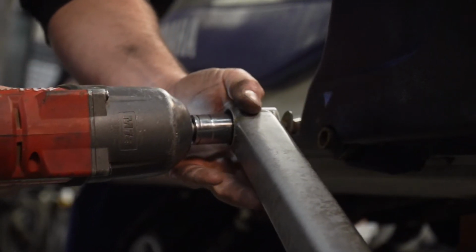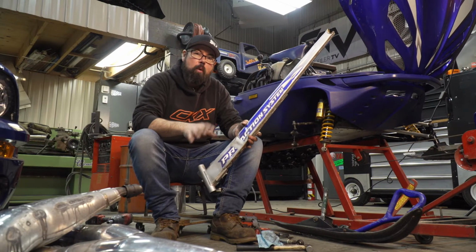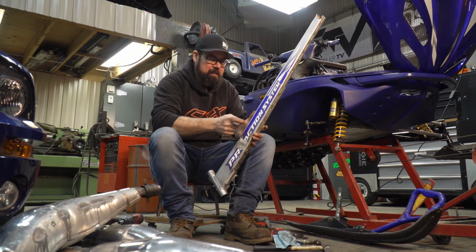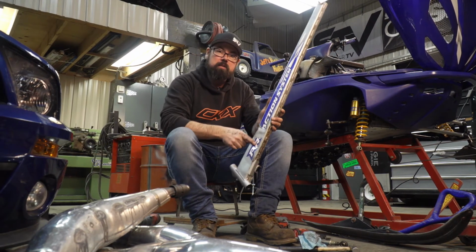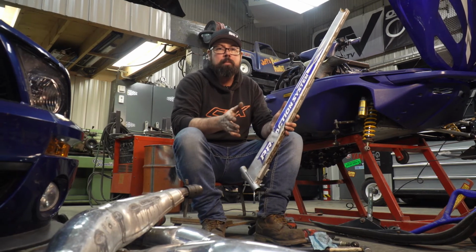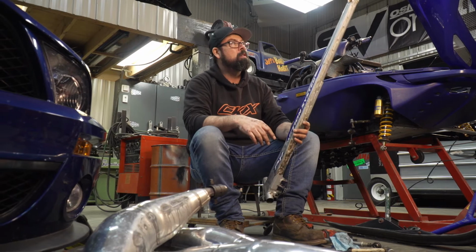Now, I ordered all the parts through Kimpex, which had just about everything I needed to replace the problem bushings and rod ends. I'm also going to change out both trailing arms because these things are built like pop cans, super strong if there's no damage, but wrinkles like this mean they can fold up on even a small hit, causing potentially more damage, so they're going away.